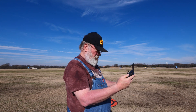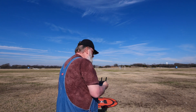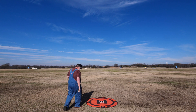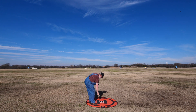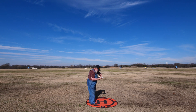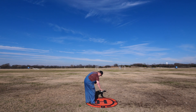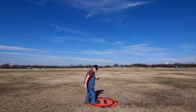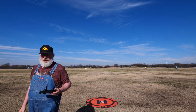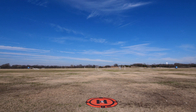Now you can turn on power to the Mavic Mini. Remember, for the sake of safety, always turn on the transmitter first, then turn on the drone. When you start the system, you may receive a magnetic interference error from the DJI Fly app. That means something in the ground caused a problem with the connection between the transmitter and the drone. If you get that message, move the drone to another spot where it's free from magnetic interference. Don't try launching when you get that message.